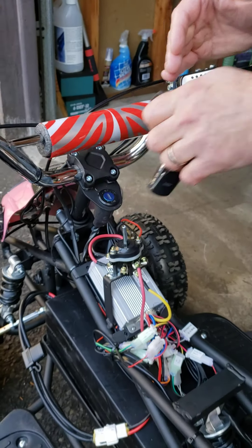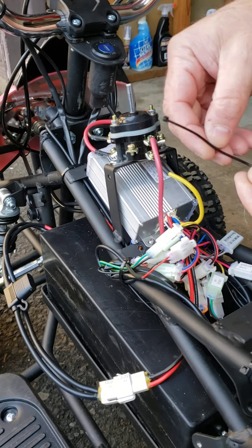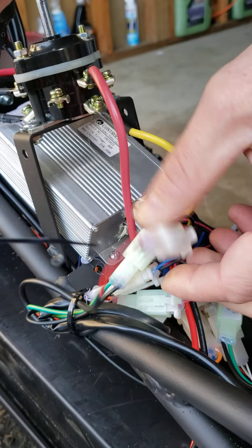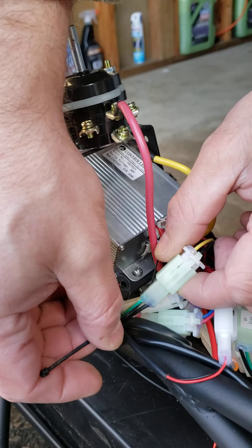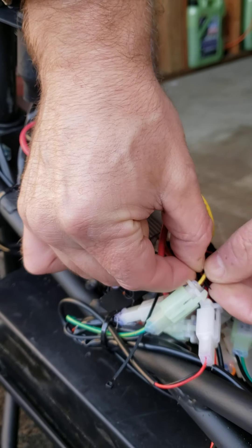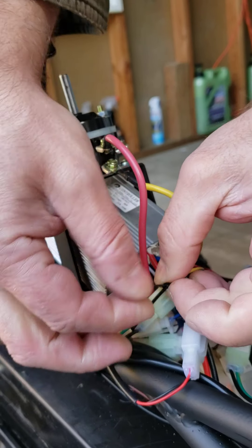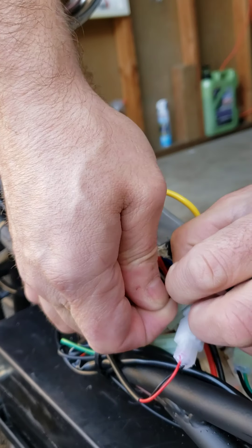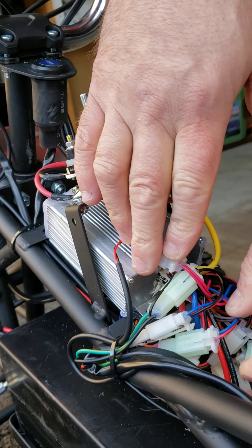Just plug back your plastic plug, and to make sure it's not going to get loose next time, use a zip tie through the wires and put it inside. I'm showing you how to use that zip tie to hold it together on a different plug — this is not the lock plug, because I'm going to show you how to diagnose it if your plug was already plugged in but your ignition is still not working.